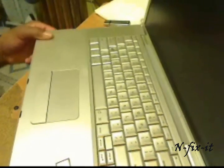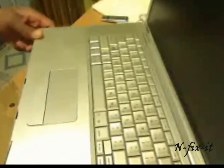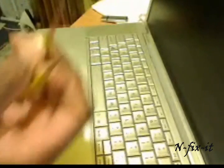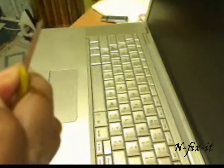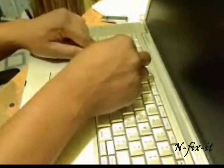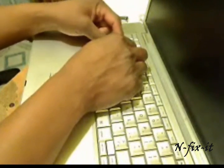As you can see on this key here on this MacBook Pro, the A key is all faded out, so that's something we want to change. What you do is have something like a flat head screwdriver or a small point, and get it into the top right corner of the key — I'm facing the laptop — so the top right corner of the key.